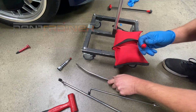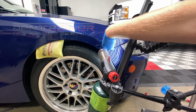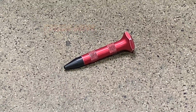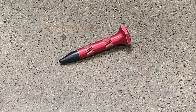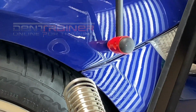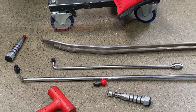And then we had issues over here with the liner, and instead of removing all those rivet clips to pull it away. Be careful on that midpoint too, guys. See, that's a midpoint tip, and if you use that too soon, you're gonna create little micro lows everywhere. It's a great tool, but we just had a little cleanup right here, just little stuff. Once we got the body line back in place, I barely used that midpoint. Yeah. Okay. All right. I'll let you get back on it.